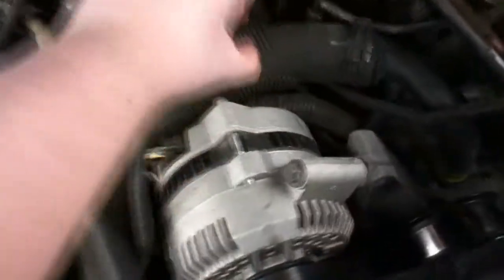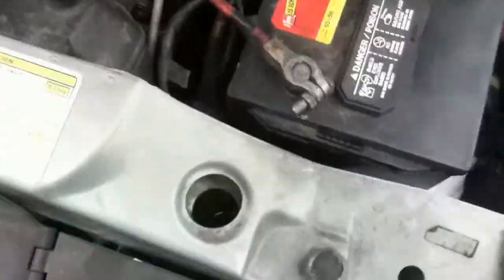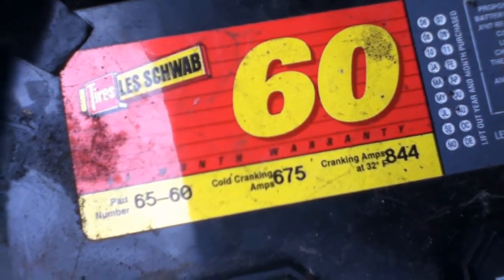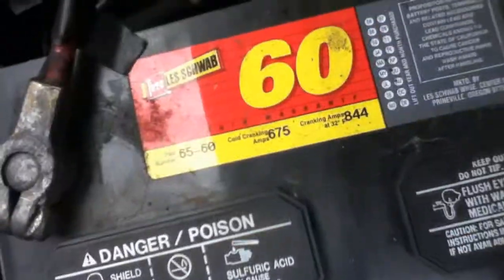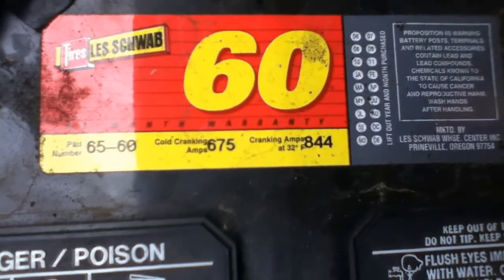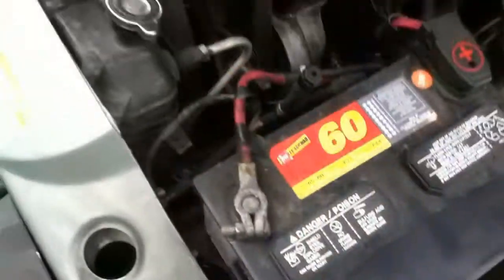Basically the hoses that will get replaced is this one here. I'll make sure we put some rags or something under there to catch any coolant. The lower rad hose down there is also going to get changed out, and then we'll get a new battery. This is a low-end battery. The red top battery I'm going to get has 800 cold cranking amps and 1,000 cranking amps at 32 degrees Fahrenheit — that's going to be pretty sweet.